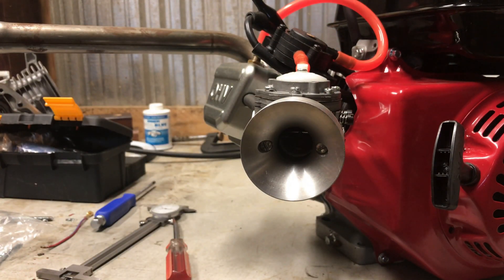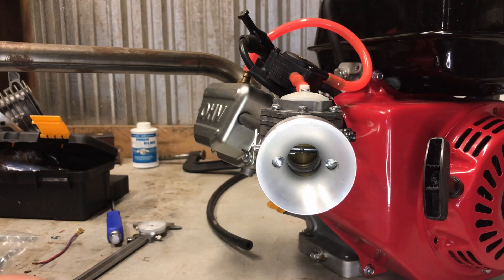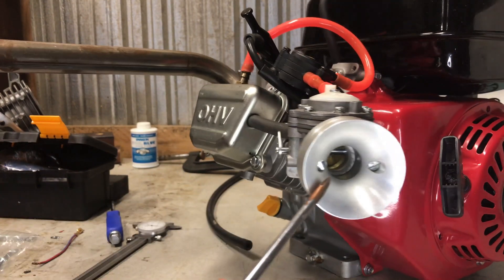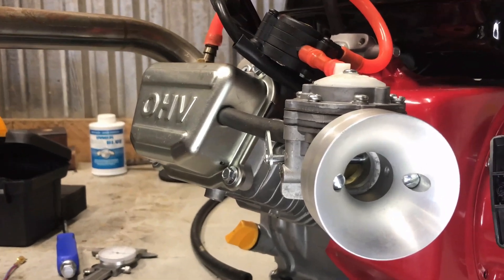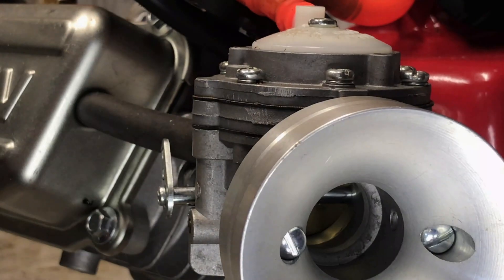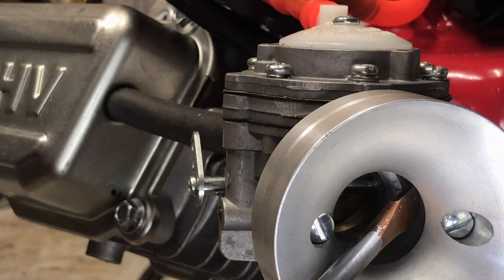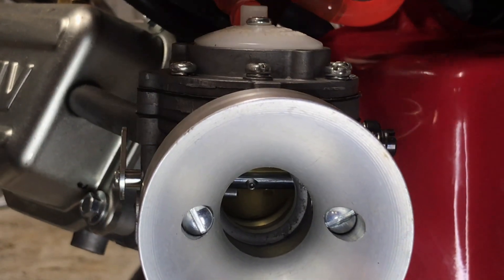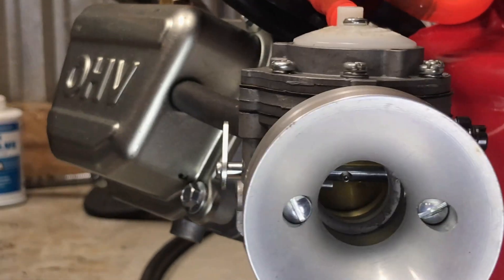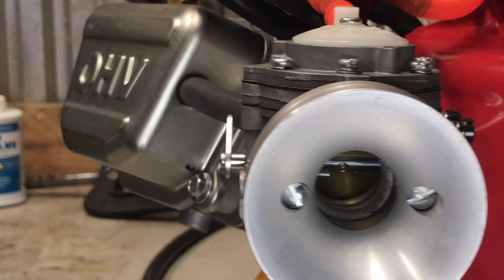For this little experiment — the carburetor is like $14, the intake was $50, and this little carb air filter adapter was $25, so we're getting real close to $100 here. The way it mounts, you can see it's a little smaller than the air horn on the carburetor, so that's not ideal. Ideally it would be a smooth finish right there to the edge of the air horn so the air could work its way in with a smoother transition.